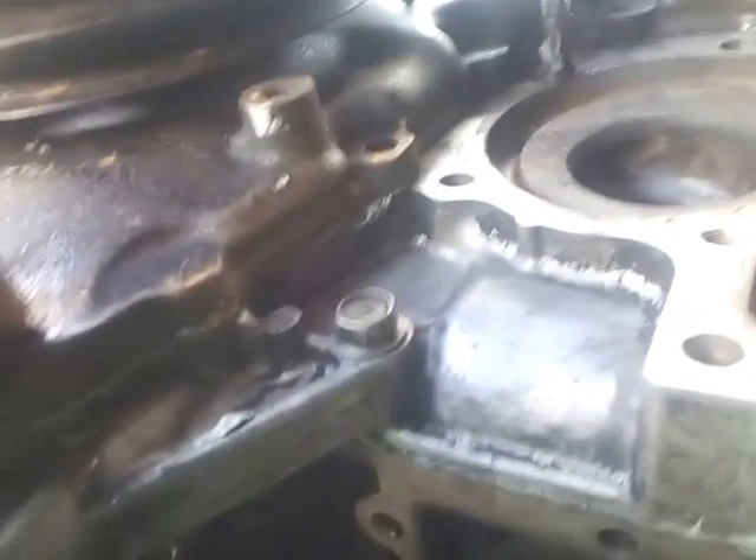You could notice too — cylinder 1, all the lobes are flat. And cylinder 4, all are active. We are going to mount all these plates and we will be back with the belt timing.